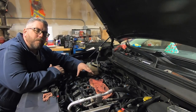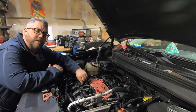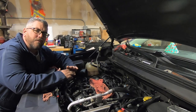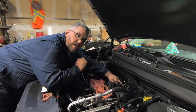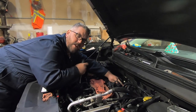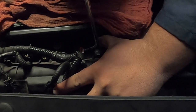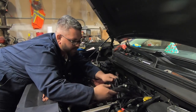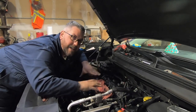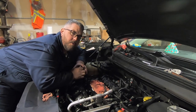With our upper intake out of the way we need to go ahead and disconnect all of our fuel injectors. It's not 100% necessary to disconnect all of the plugs that go to your coils, but personally I like to disconnect everything and just push it all out of the way so I don't run into any problems. On your fuel injector plugs you're going to have a red locking tab — that tab just needs to lift up and then you'll be able to squeeze it like a regular connector and pull it out of the way. Once it's all loose you can just tuck it in here out of the way.